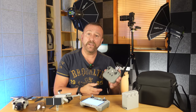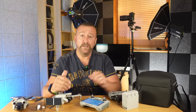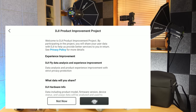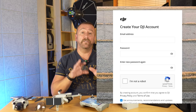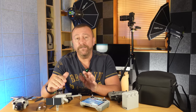If you've got the N1 remote then you'll need to hook your phone on, open up the DJI Fly app, and start that up to see what's going on and to update the firmware. Either way, it's important to complete the setup questions the first time you fire up the RC remote so it knows how to connect to your home Wi-Fi and how to update itself and download the firmware. You're also going to need to enter your email address — beforehand I'd suggest you go to DJI.com and sign up to create your free account. This is the same email address you enter in the Fly app; if you don't, the drone will be stuck in beginner mode and will not fly very high or very far. It's also a way of syncing your flight logs.